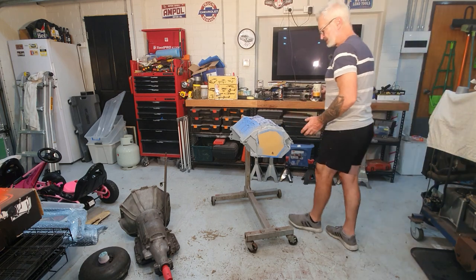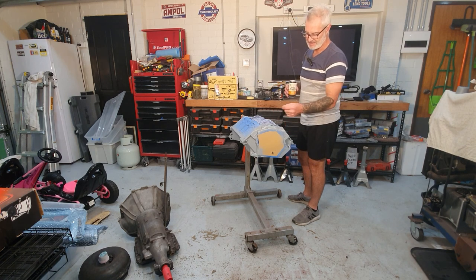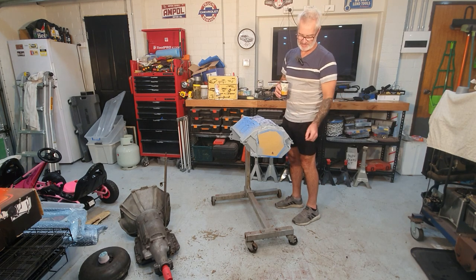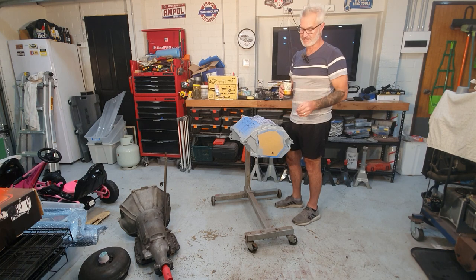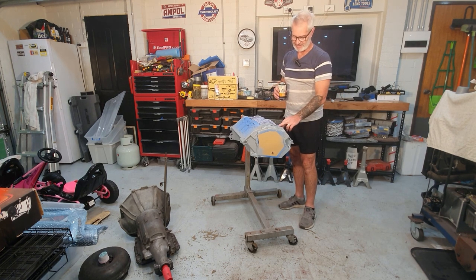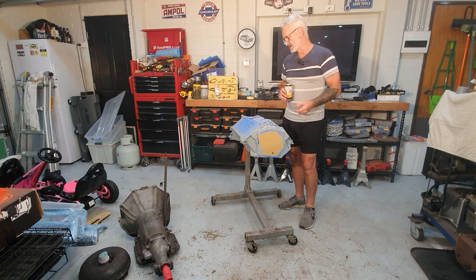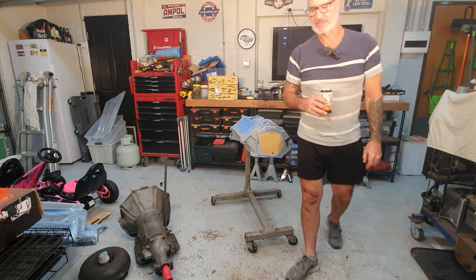Anyway, hope you enjoyed that. It's pretty simple. It's nothing technical about what I did here. Just take your time, tape up everything, put your gasket on there, mark around the sides of them all, cut them with a razor blade, keep the lines nice and sharp, keep them like 1 millimetre underneath where the gasket's going to actually sit, and you'll have awesome straight lines underneath your gaskets. You'll be very happy with the paint job on it, and with the finished assembled engine. So keep watching, and I'll show you what she looks like when she's fully painted up in the Holden Early Rocket Red. Thanks for watching.